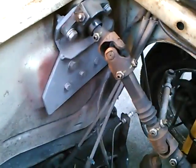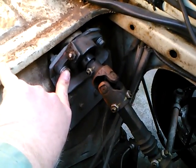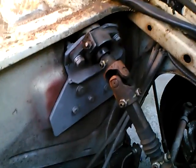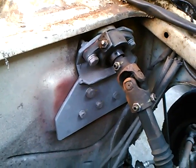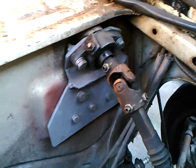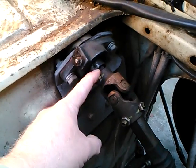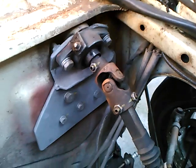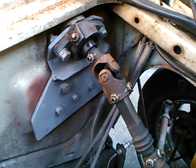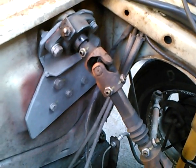The key points are: you need to add a bearing to the steering column, because otherwise nothing is supporting it. I used this industrial bearing, and that's been part of my system from the start. But this much more heavy-duty bracket was part of my second generation. The three-quarter inch spline shaft inside from Borgeson is welded inside to the stock column. And of course, I can't run the stock horn button anymore because I can't run that ground wire through the middle of the steering column anymore.